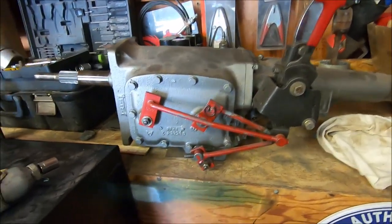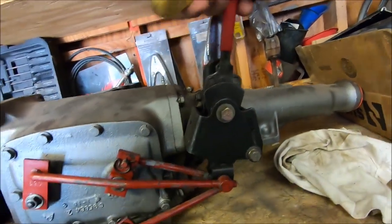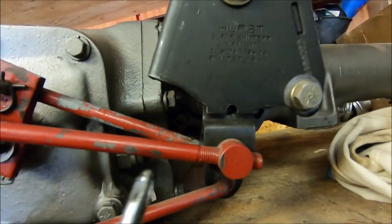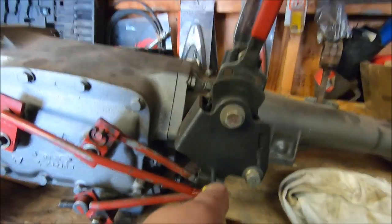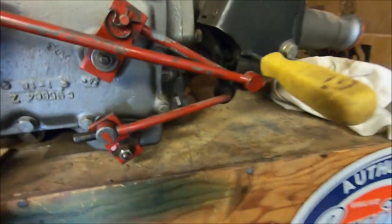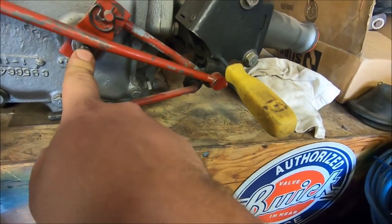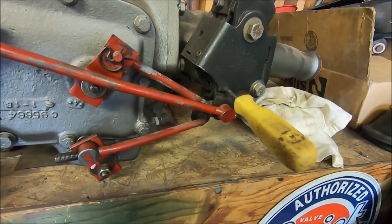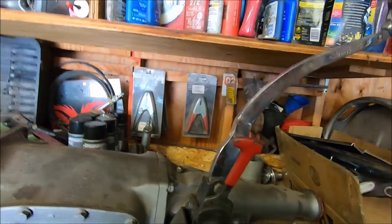Real short and sweet, I wasn't expecting it to go that easy. But yeah, basically all you need to do - like on this Hurst super shifter, it has a reverse lockout. You want to put it in reverse lockout, and there's that hole right there. A nail, screwdriver, something like that - get it in there and it locks it so you can no longer move that. And then from there, you just take these off, thread them in, thread them out, until they fit perfectly on here. You don't want to force them on there. And once they fit perfectly, you can pull your screwdriver out - bam - and you have a perfectly shifting shifter.